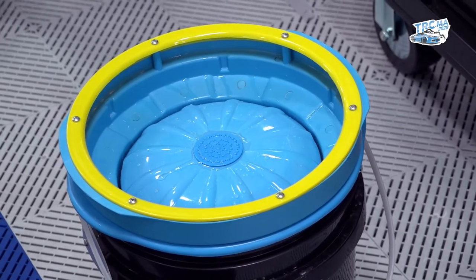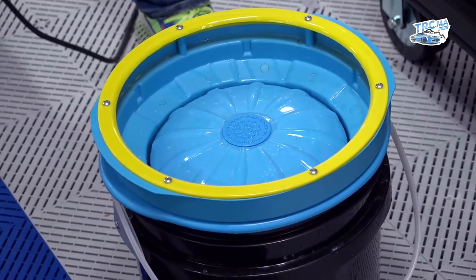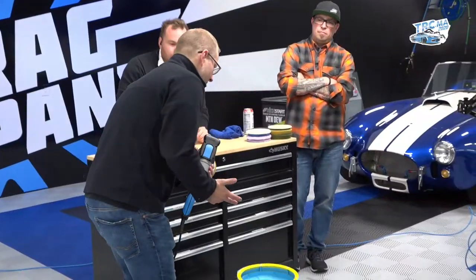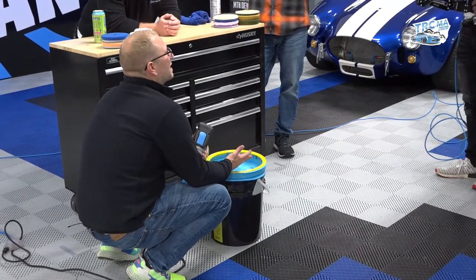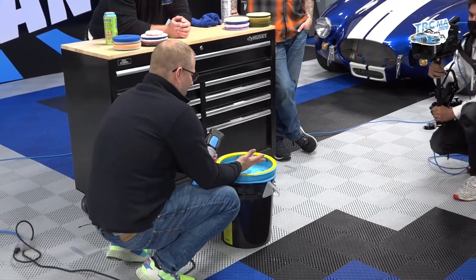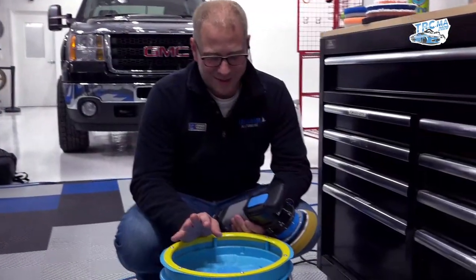One of the things I need to stress as much as I can is that even though we've made a lot of upgrades, realistically, a lot of the failures and the damaged parts that we see are because people are using their polisher at like speed 5 or 6 when they're cleaning their pads. Right. You really need to drop it down. It's going to be much easier to use. You're gonna have so many less problems.